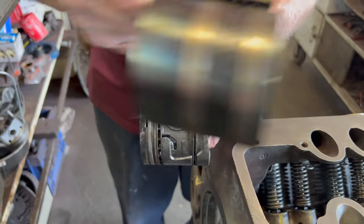That magnet tool was originally an aftermarket tool made to put valve clips in maybe a flathead Dodge from '49 or '50 — it was designed to do a valve job in the car without taking the motor out. I take the two locks, put them on the magnetic end, push them right down in there where they're supposed to be, clamp it, let the spring up, and we're done. Sometimes having the right tool just makes all the difference — and knowing how to use it.